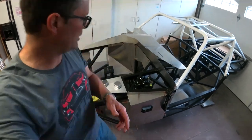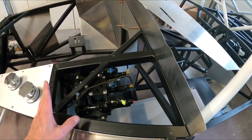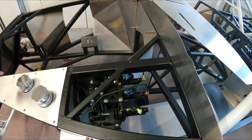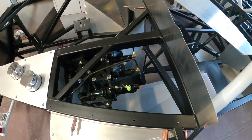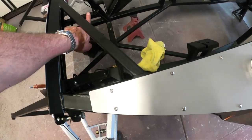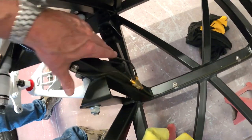The front brake lines are now complete, other than the flex line. Coming out of the master cylinder — after thinking about it more, I should have gone underneath this tube, but I wanted to use the hole that was already there. It comes down here, across, picks up the junction from hard to flex line over there, with a quick bend. Turns out pretty clean.